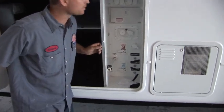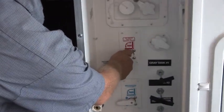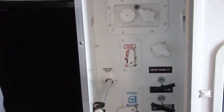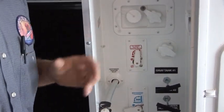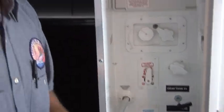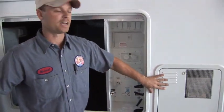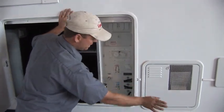This particular unit, it's a Bighorn, it makes it really easy to winterize. You can bypass your hot water heater by simply switching the valve to bypass. Basically what you're doing when you bypass the hot water heater is you're allowing the winterization fluid to circulate through the plumbing lines without actually putting 12 gallons into the hot water heater. It's going to save you some money and a little bit of time. So you bypass the hot water heater — now we've eliminated that hot water heater.